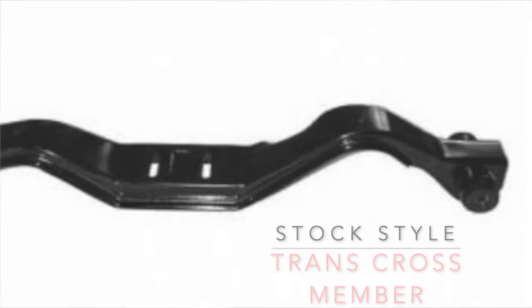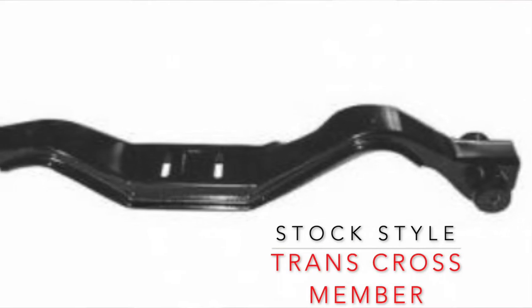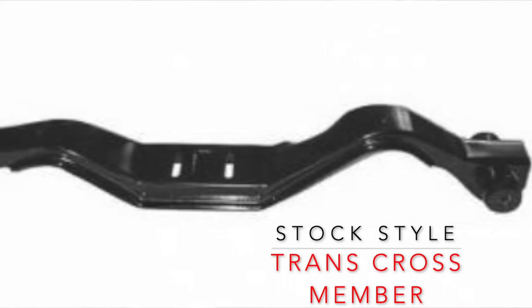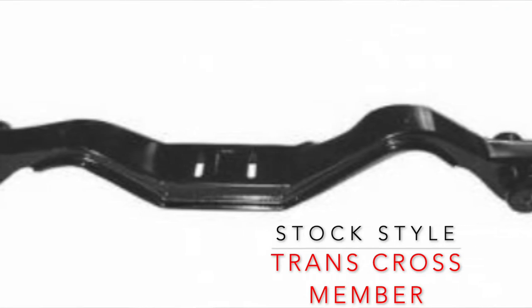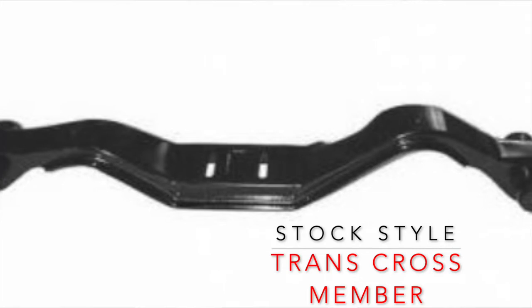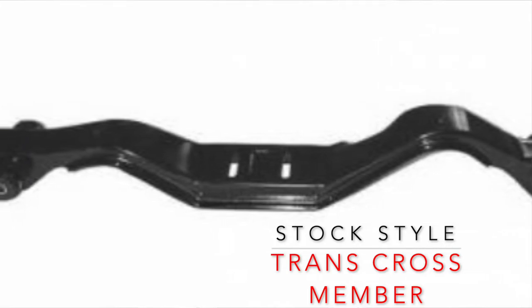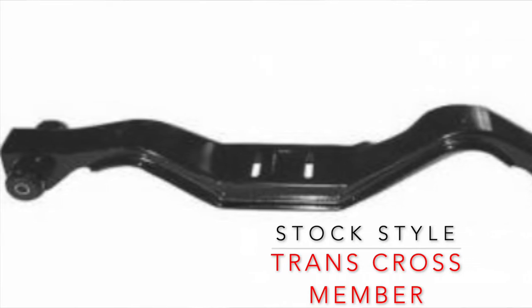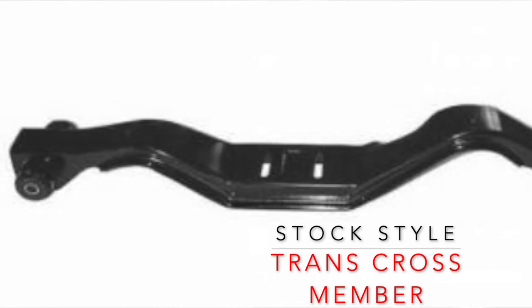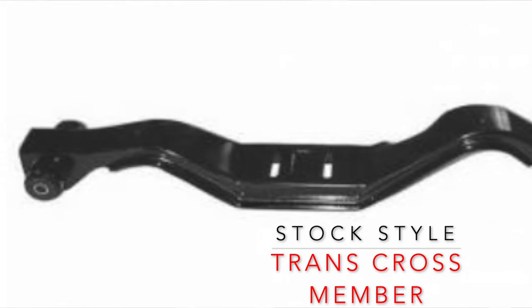And then the other thing you need to make sure that you do is that the adjustable, there's a difference between the AOD and the T5, and they do make an adjustable one so that you can slide the arm back and forth, or the cross member back and forth. There's another set that is fixed. I'll go over all this in the video, but just make sure when you're getting ready and get prepped, make sure that you do have the correct cross member and that you have the correct exhaust hanger.